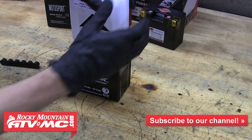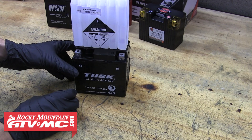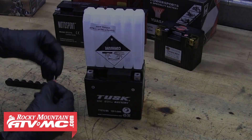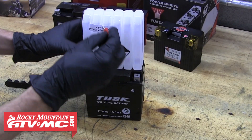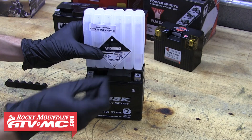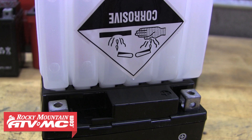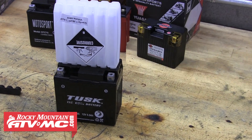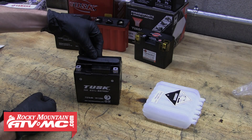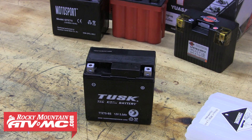Go ahead and sit the acid pack onto the battery and puncture each of the cells by pressing the acid pack down. You should start to see bubbles appearing in each of the cells, meaning the fluid is making its way into the battery. To help speed the filling process up, use the provided push pin to poke a small breather hole into each one of the cells — now you can see the fluid flowing in a little faster. It's critical that all the electrolyte from each cell in the acid pack is emptied into the battery; let the battery sit for 30 minutes to an hour to make sure this happens. Once it's sat long enough, remove the empty acid pack from the battery and install the battery cap by pressing it down with your fingers — do not use a hammer. Now this battery is ready to be charged.